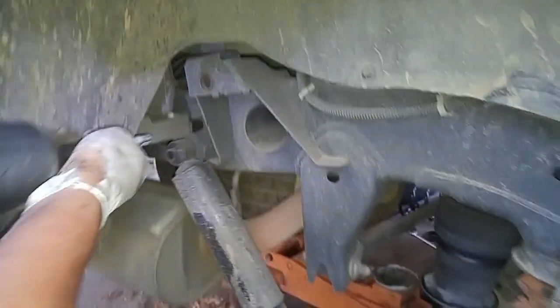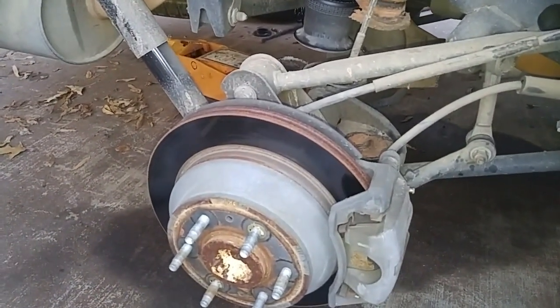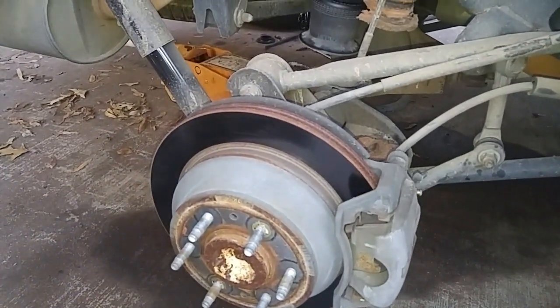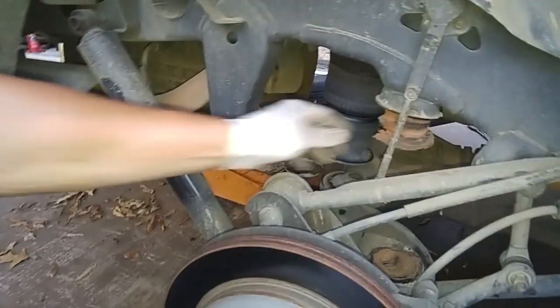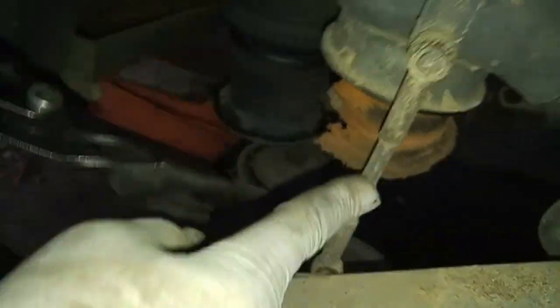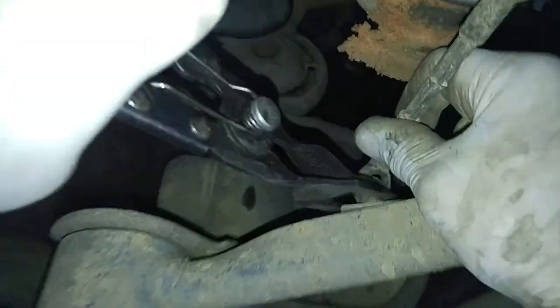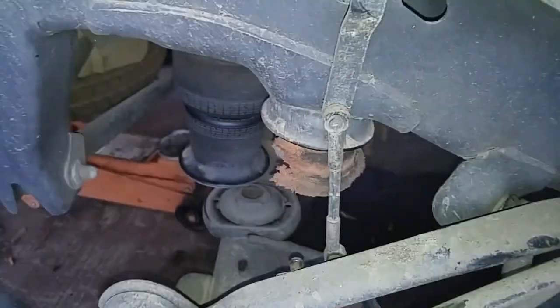We took the shock off the other side, so that's why this side dropped the extra distance. So when you're doing this job, you want to have the shock absorbers removed on both sides. We have a level sensor over here which we don't need to use anymore, so we'll just pop this off. Now we'll take this shock absorber off.